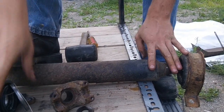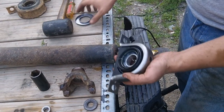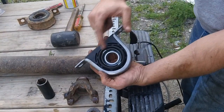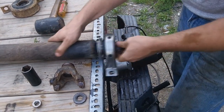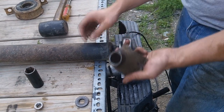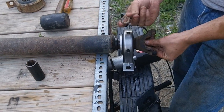Now we're going to get the new one put on and make sure we get it going the right direction. We've got our old bearing off and need to put our new bearing on — I'll make sure in the description to put exactly what model number this is. Your plate goes on first and should go all the way up to the shaft piece. Your bearing goes with the flange going towards the front, so that goes on next. You should be able to rock it back and forth and tap it slightly on. Then you've got your yoke, your washer, and then your nut.